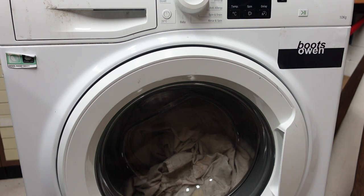It's taken on a lot of water. I hope it works. But I can always put on a rinse and spin, or a spin and drain cycle. I don't see the motor turning. Could be an inverter problem, could be a motor problem. The clock's going down but it is not turning. Not good. I have a feeling there's a motor issue, so I can have a look at it and see what to do.